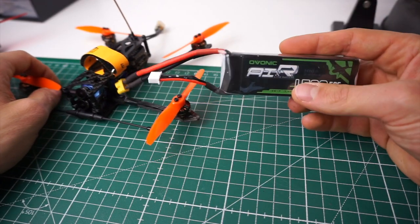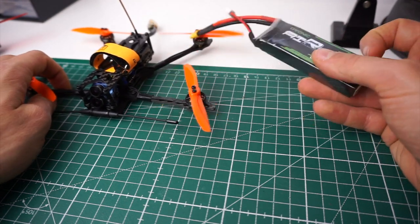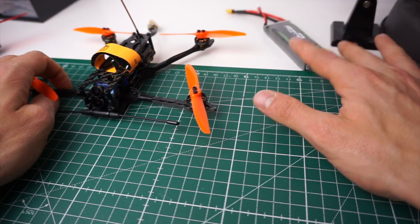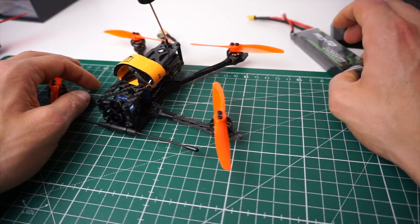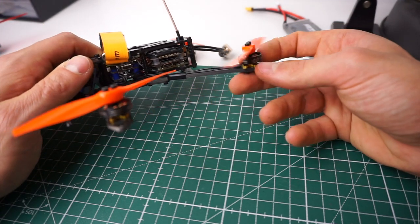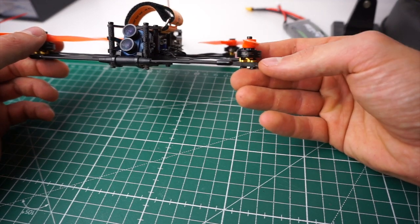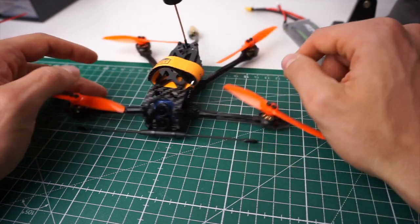Another surprise: I tried a big 1500mAh 2S hoping to get really good flight times, but surprisingly I hardly got more flight time out of it than a 650mAh 2S, which is not even half the capacity. That doesn't make any sense to me — I can only assume the weight puts too much load on these props, making the whole thing go inefficient. These are props for a micro build and I'm not sure if they get inefficient under too much load.